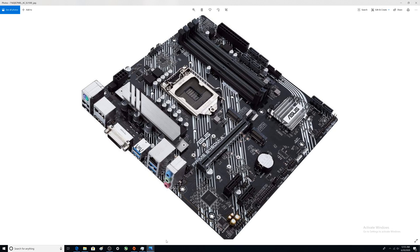This is Micro-ATX, so you're somewhat limited on PCIe slots. For audio, video, and Ethernet: there's the old-school PS2 port — I don't know why they bother with this in 2020. There are two USB 2.0 ports. You have DisplayPort on top, HDMI, and dual DVI. As long as you don't buy a CPU with an 'F' in it, you can game without a dedicated graphics card. There are four USB 3.0 ports, Ethernet, and headphone/microphone jacks.